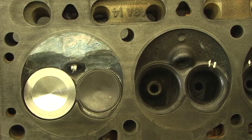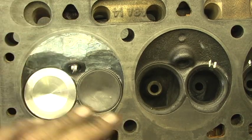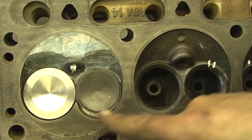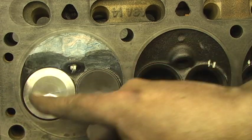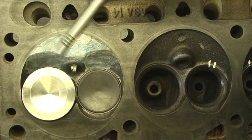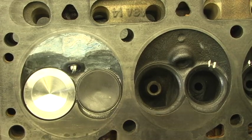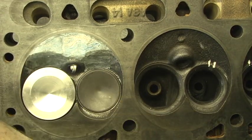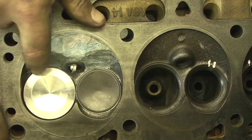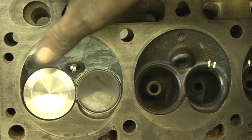I just wanted to show you how I clayed that up. This is going to be real close to the chamber shape minus this. I'm going to CC it and get a volume so that I know how much volume just the clay is, and then I'll unshroud this and re-CC it again to see how much it took away. This way I can keep tabs on it. I've got a pretty decent curtain. I do have a measurement that I make right here — a swoop — and it's actually called a curtain. I just kind of form it with my fingers; I'll be doing this with a grinder. Believe it or not, I'm actually better with a grinder than I am with my finger.